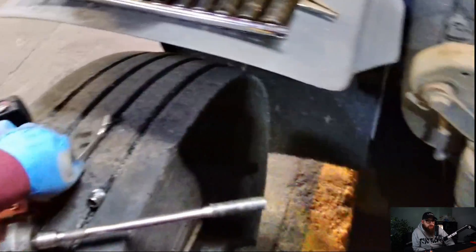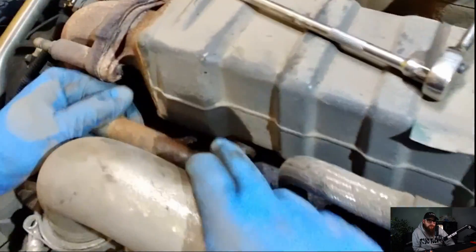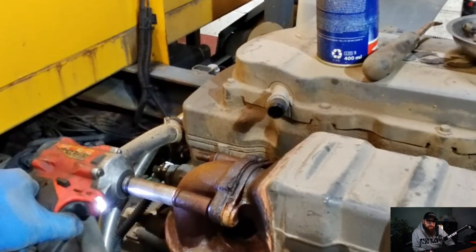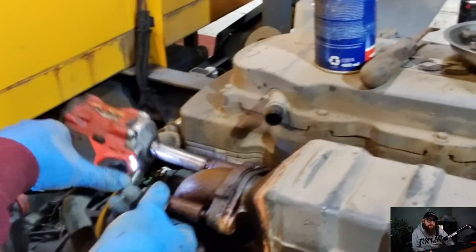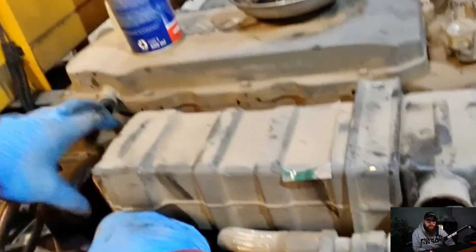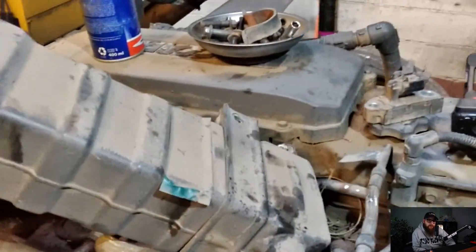With our various nuts, bolts, and heat shields removed from the EGR cooler, I'd managed to snap the bolt holding the coolant pipe above the VTG actuator off, so it's something I'll need to extract later. Seeing as I'll be getting new gaskets and O-rings later, the bolt's something I can pick up when I pop into DAF for the gaskets.